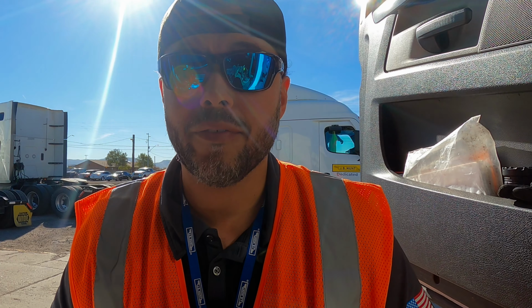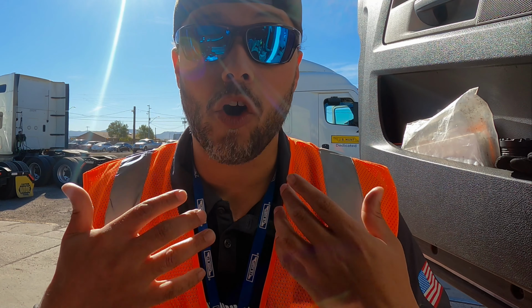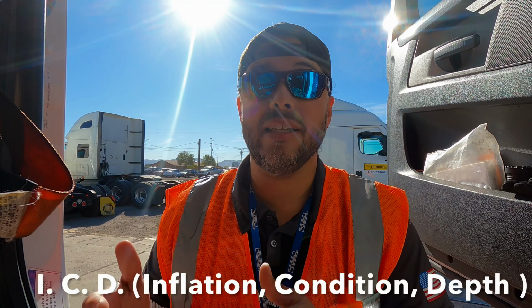ABC. Abrasions, bulges, and cuts. LLL. Lights, leaning, and leaks. Note that leaks doesn't necessarily have to be anything like fluid. It can also be an audible leak, like an air leak. ICD. Inflation, condition, and depth. All right, so now let's begin.